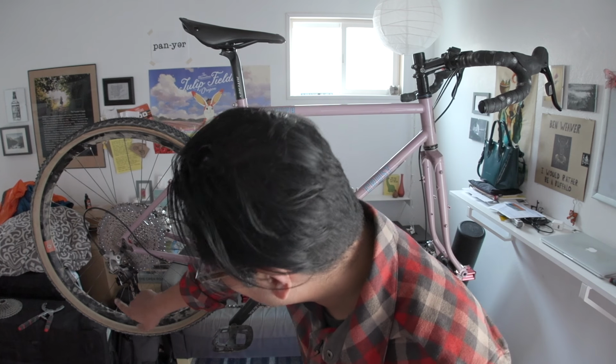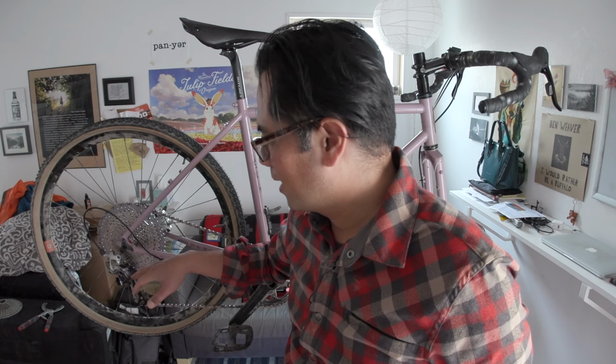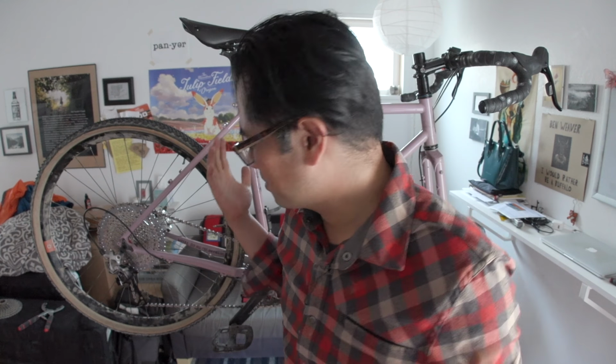It was making a bit of a clanging sound, which I thought was the derailleur pulley hitting the cogs or something. But looking at it, it's clearing it okay. I did add a couple more turns on the B-screw to hopefully alleviate that. It might just be that it's a really loud cassette at this point. So I'm tentatively calling this a success.